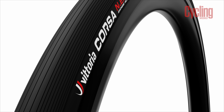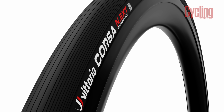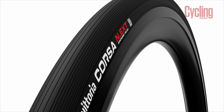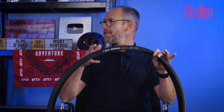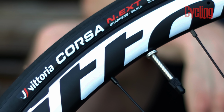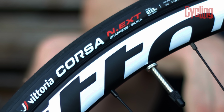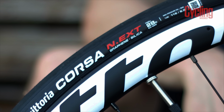It's got some really good figures though, actually. It weighs pretty much the same as the cotton casing Corsa, just over 300 grams. To make it more resistant and more durable, they've added silica to the compound as well as graphene, and that apparently also improves its wet weather grip. So it's got good wet weather grip, good durability, good puncture resistance, and costs a bit less than the Continental and the Schwalbe. Is this tubeless as well, or is it tube type only? It's tubeless, and it's actually Vittoria's first hookless compatible road tyre.